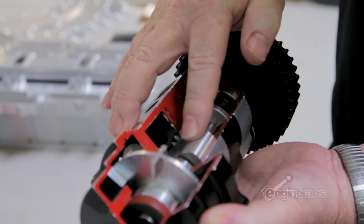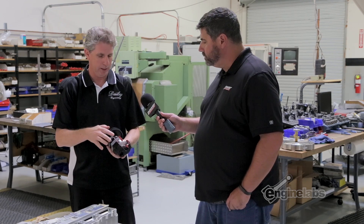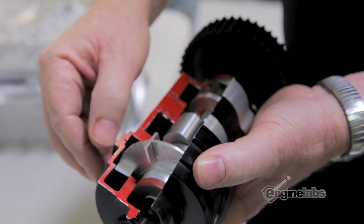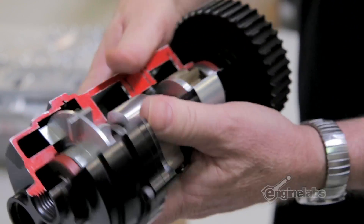The roots-style rotors are like little superchargers. They're what are used to scavenge the oil and air out of the motor. The key is we're scavenging exhaust blow-by gases — that's air. What this does is act as an air separator. We collect all the scavenge coming out of the back of the pump through the scavenge sections into the air separator.